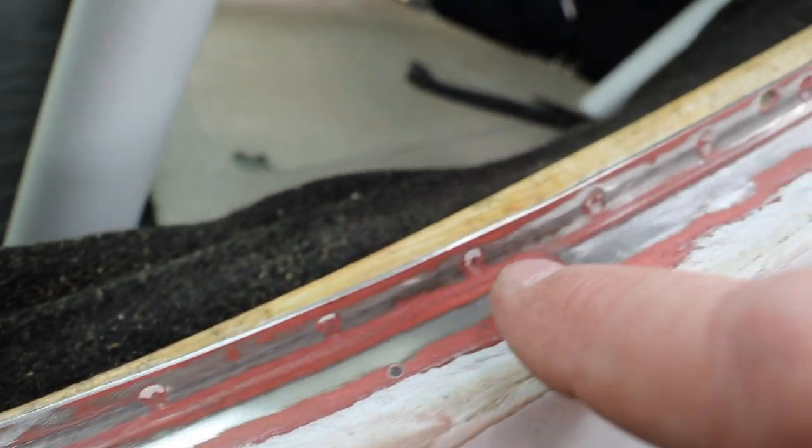So this is what we're looking for here. Now that I've exposed these, you can see where the spot welds are. And I've ordered a spot weld drill bit, but it's not in yet. So I'm gonna give a go at a regular drill bit and just try to be careful that I don't go through each side. The goal here is to drill out all these spot welds,